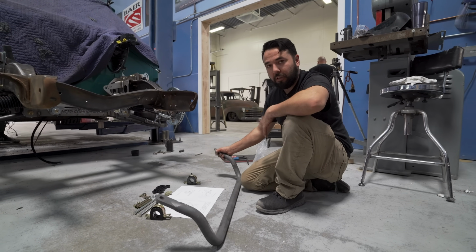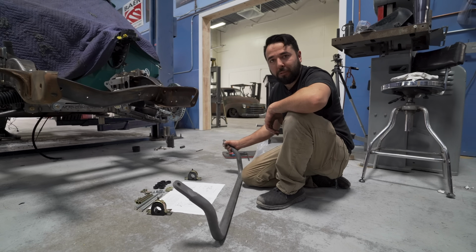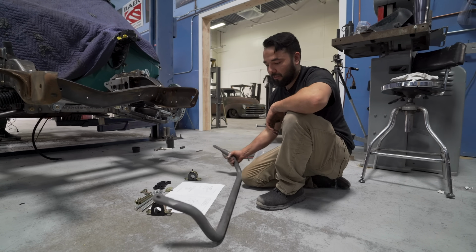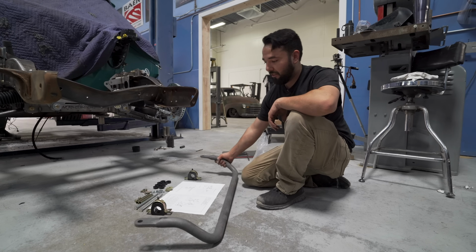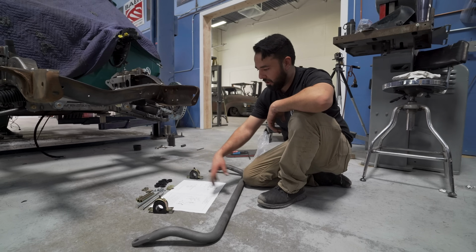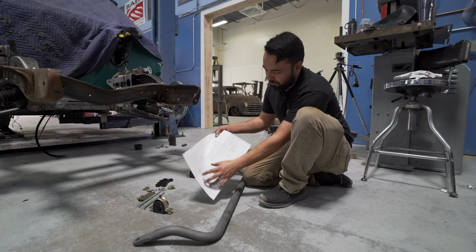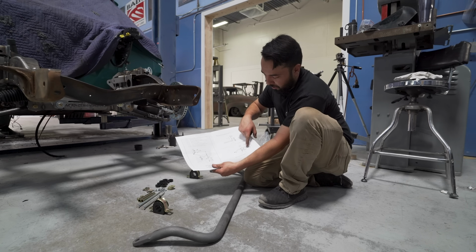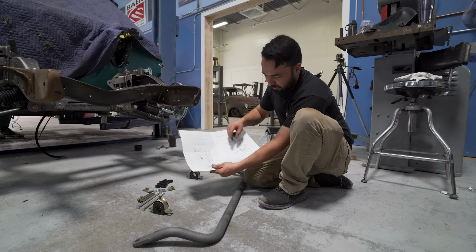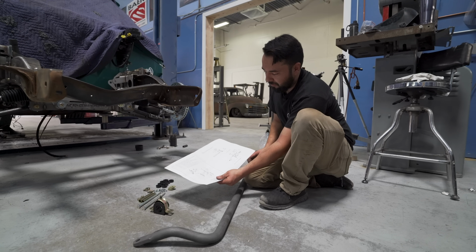All right, onto the sway bar. The kit comes with a 1 3/8 solid steel bent, formed, and stamped sway bar. I mean, this thing is really beefy. It comes with all the hardware, just like everything else. Comes with the bushing and the spacers. Also comes with a good instruction that tells you from the center of the sway bar to the front of the crossmember is 13 5/8. So we're gonna do what it says to do on here.